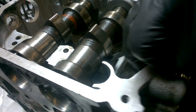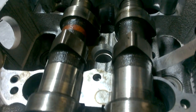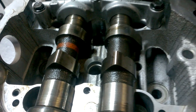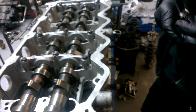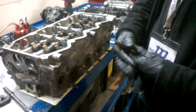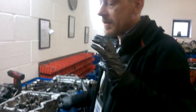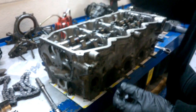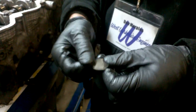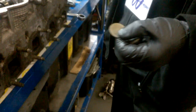It should be able to slip under there perfectly, and you can tell the right size because it just grips it. If you can't get it underneath, you've got to resize it. If the valve is too tight — because metal expands when it gets hot — you can actually end up pushing the valve open. These have solid shims, not hydraulic.